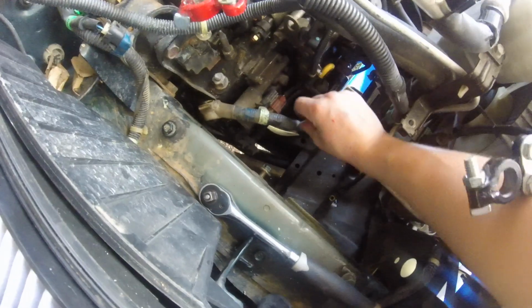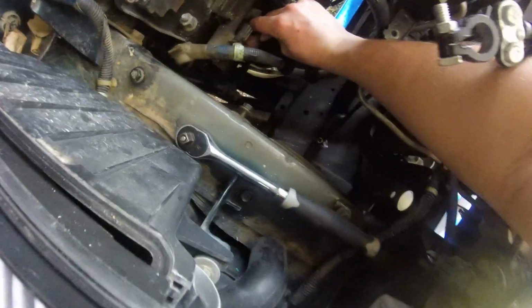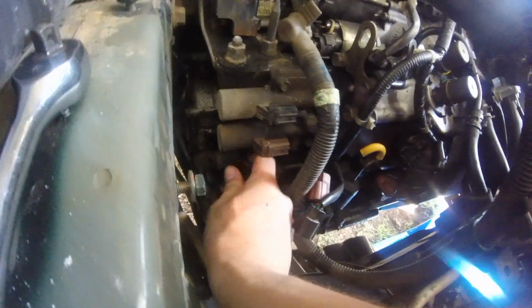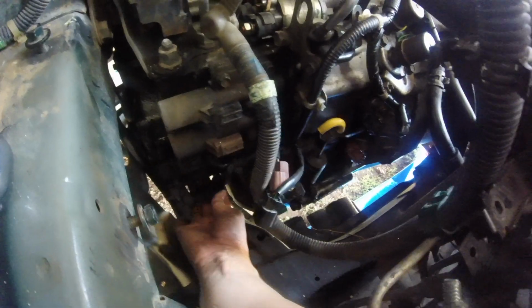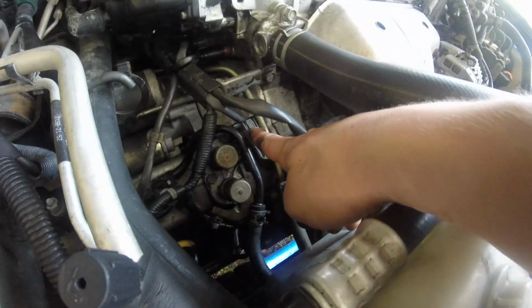Remove the transmission ground cable and disconnect the connectors from the clutch pressure control solenoid valves A and B, main shaft speed sensor, and third clutch pressure switch. Then, remove the harness clamps from the clamp brackets. Disconnect the torque converter clutch solenoid.